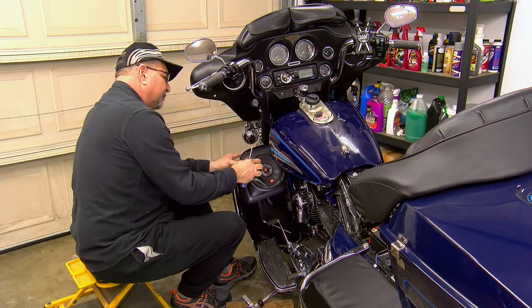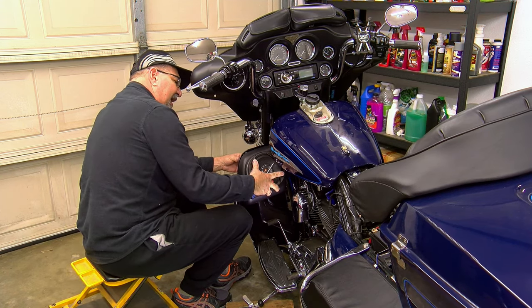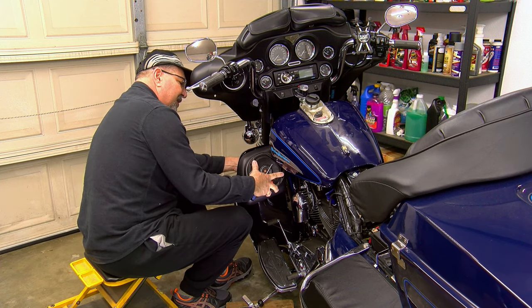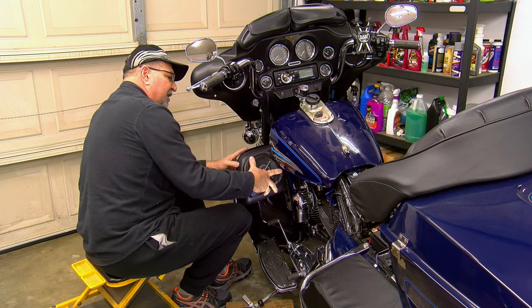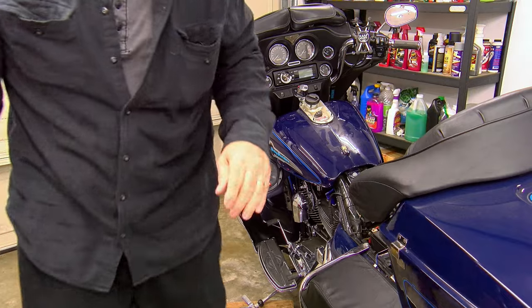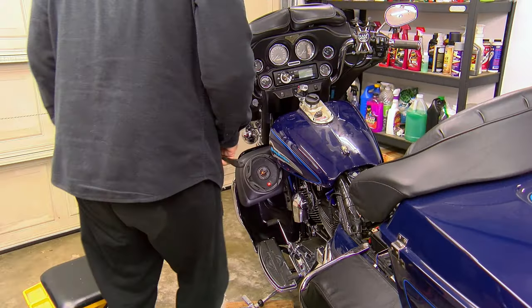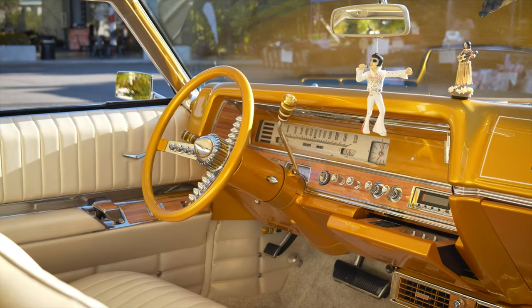As I got ready to secure the upper fairing to the engine guard, I noticed the farther I pushed it in, the speaker covers were hitting the tank. That could be rectified with different speaker covers — these were sticking out a little too much. I do have some speaker covers I'll replace them with. I'm not able to get the top of the fairing fully in, though it's not that far from the frame. After this, I'll replace those speaker covers with low-profile ones.